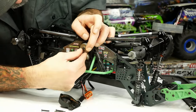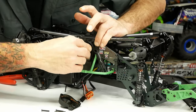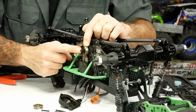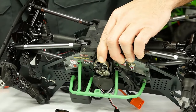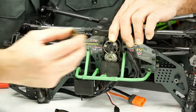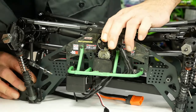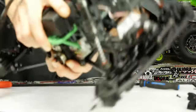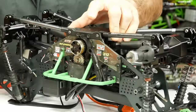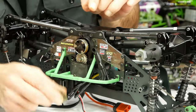If I didn't know better, I would say that this is missing a clip off the end of it. I'm gonna have to find a parts manual, but I can see that little notch — that groove on the shaft. I'm almost sure that should have an e-clip holding this pack together, because right now you're using the outer case bearing to hold that pack together. It's apparently not in there, so good find. We need to do some investigating — I don't think I'm wrong; I think they might have missed it from the factory.